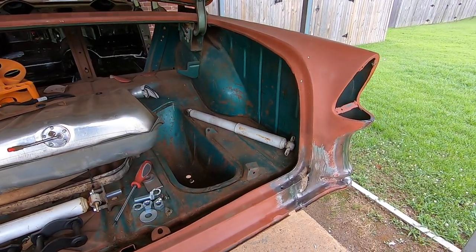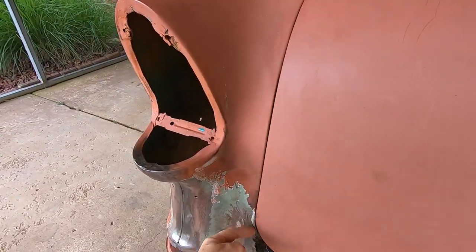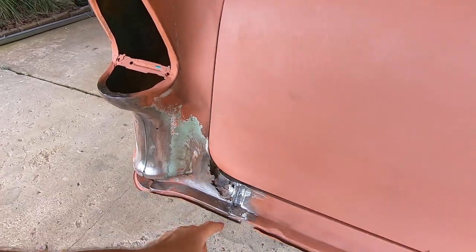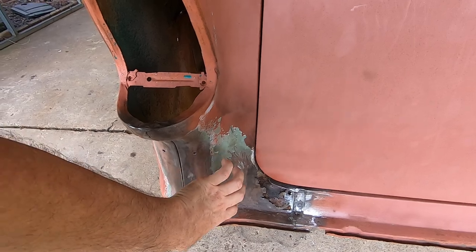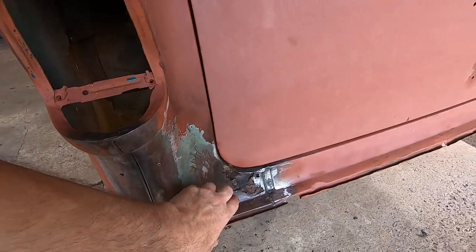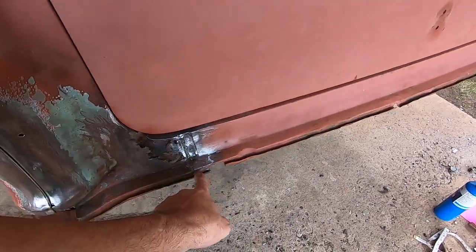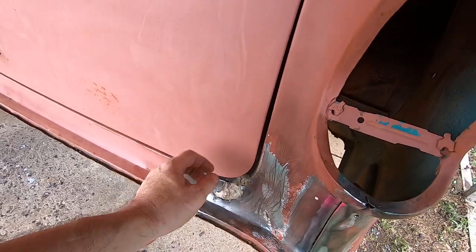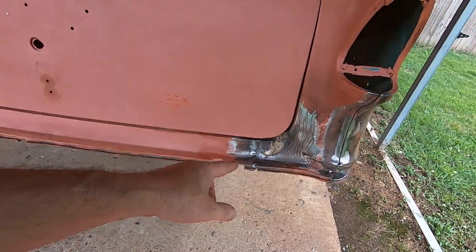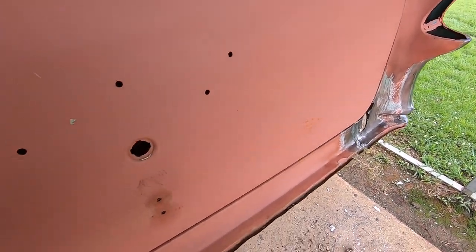On this car, if I can't get it tweaked over to where it takes up this gap and opens up this one a little bit wider — when I cut this section out, I'm going to bend this out, pull this part of the quarter out and just add that much more to the piece that I'm going to put in there and butt weld. I'll do the same over here — cut this out and pull this over. Even though the inner structure is still going to be attached, you will be able to tweak that just a little bit.